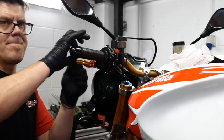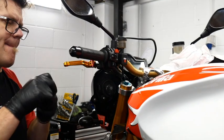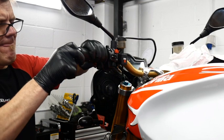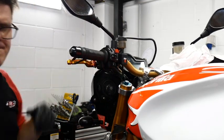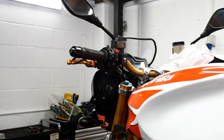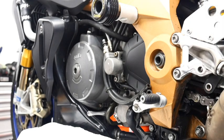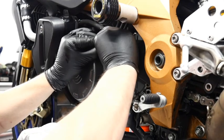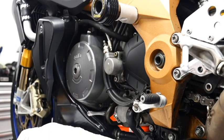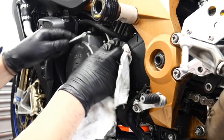Welcome to the voiceover section — this is all a bit new, so bear with me. First, fit a brake band: basically put a little bit of pressure on the clutch cylinder. The brake band we've got is a piece of bicycle inner tube we've cut up, just to put a little bit of pressure on it. This here is the slave cylinder — this is the part you're going to replace. Because we've got the brake band on we do have a little bit of line pressure, so it is going to make a bit of mess when you open it up. Open up the bleed nipple just to let off the pressure.